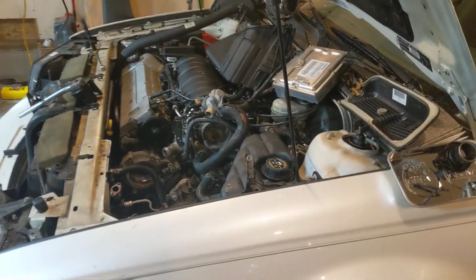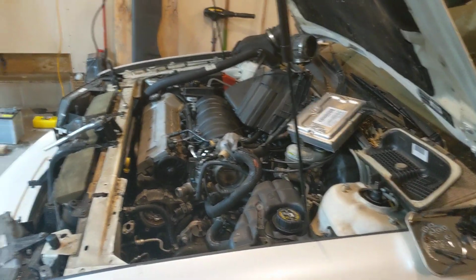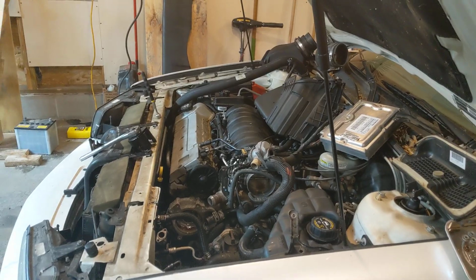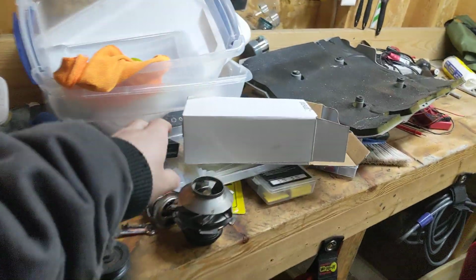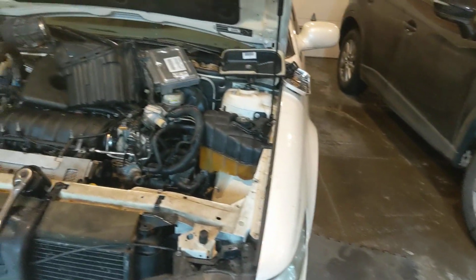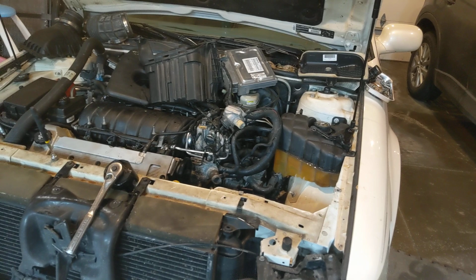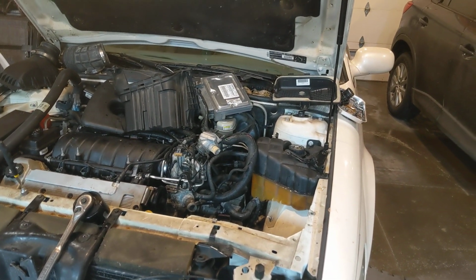I was buzzing around in the Cadillac the other day, and I noticed that my temperature gauge was about one click too high. I plugged in my scan tool, one of these blue drivers, and it monitors all sorts of things, live data, including the coolant temperature, and I verified that in fact it was running a little warm.